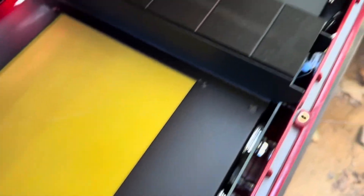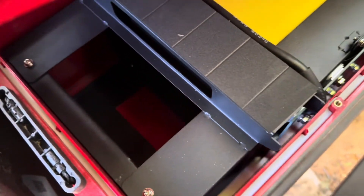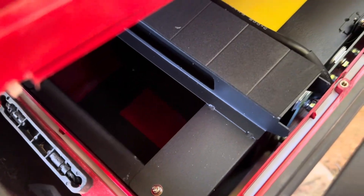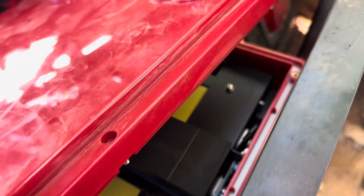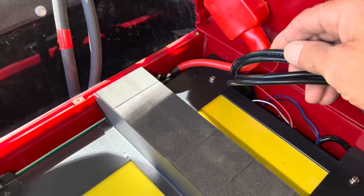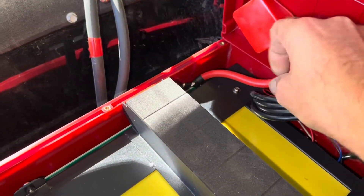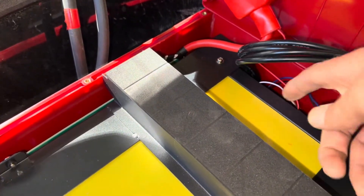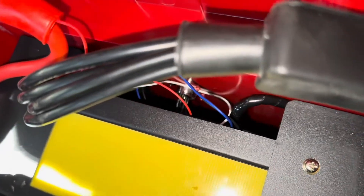Check that out — nice metal reinforcements all around the cells. That explains the weight shift to the passenger side I was talking about — there's a little bit of open space here. It was only a 12-cell battery; looks like that's probably the same case they use for a 51.2-volt battery with room for the extra four cells. At the terminals: the negative has four number-ten lugs, there's a number-four positive lead, and all wires are silicon-jacketed.